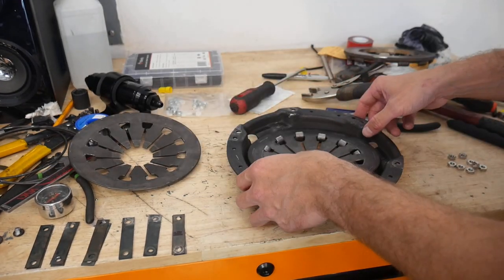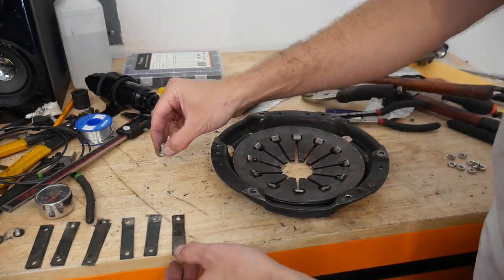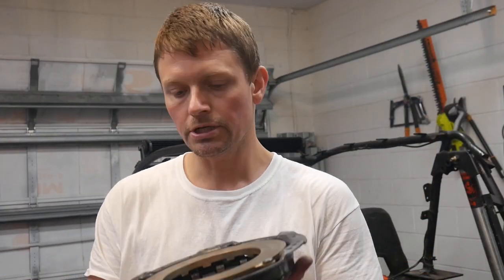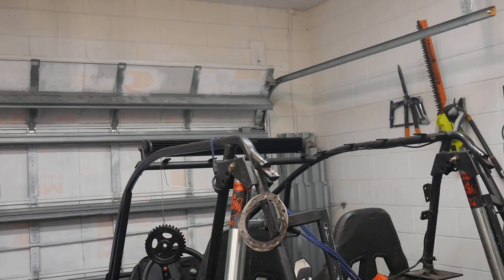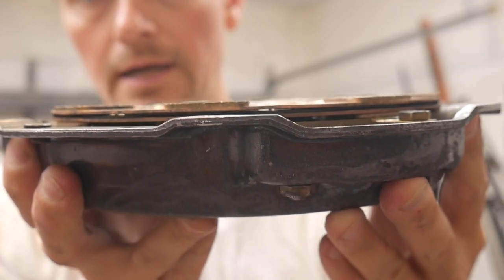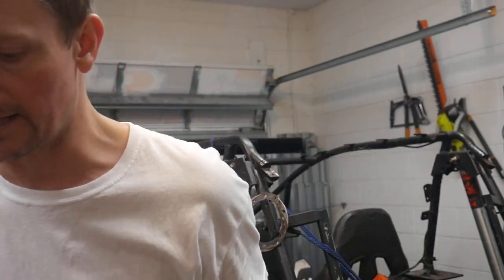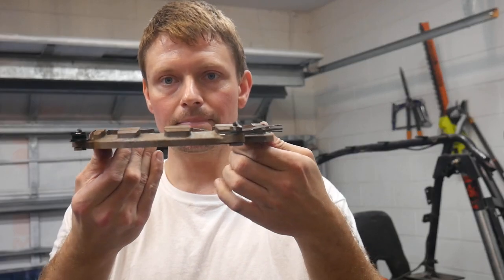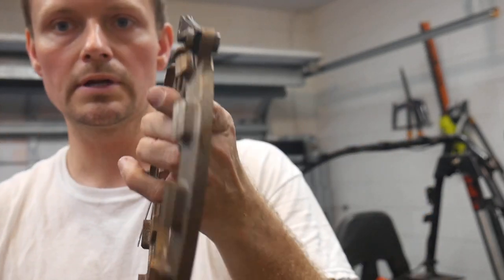I'm going to jump ahead and show you some footage from about a week later. There's an issue you need to be aware of during assembly that I wasn't aware of until the clutch came back together. I did a test fit with the clutch, and one of the things I'm realizing is it's not sitting at the right height. When our clutch disc drops into the basket, look at how much higher it sits — that's because of the additional thickness of the second spring diaphragm. I'm going to show you a corrective measure: I'm going to put an angle back on these pegs the way the originals are done, which will also drop this down further inside that basket.